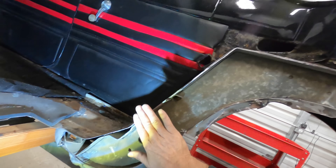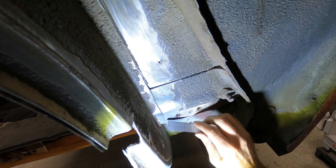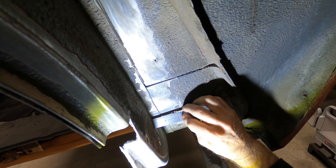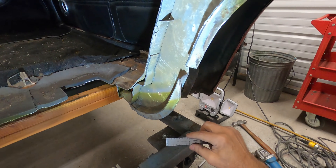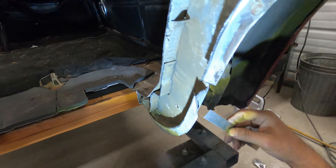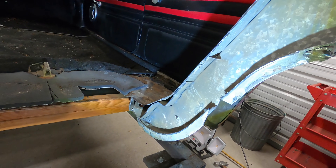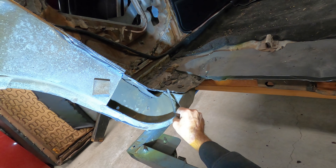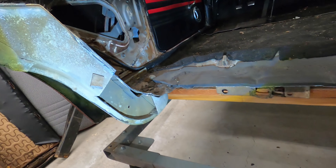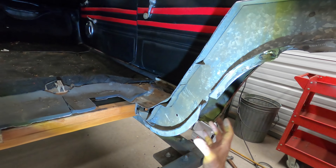I'll use 80-thousandths chromoly plate and blend it back in, then make another wall one inch inside of this because I need room for the link. I really don't have more than an inch to go in this direction, so I'll make another plate that mimics the whole thing. It won't be two inches wide — it's going to be an inch and a half wide — but it will be three plates thick, so it should hold that area. This area over here is not as problematic because that's all the room I need. I'll just make some plate, plate that area in, and call that part good, then move on to the other structure later.